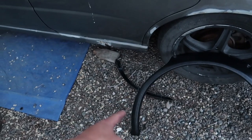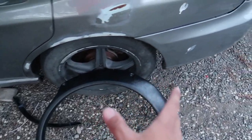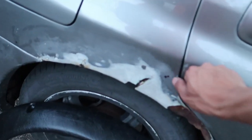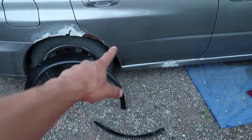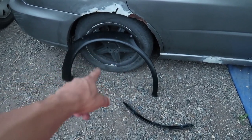After looking at this for a bit, I think I can make them work. I'm pretty sure I can make the door piece work and make the rear fender work — it's going to have a lot of stretching, but I've got all my markings on this side. I think I'm going with a dot up here, one here, and then one down there. The door piece I think I'm going to shave so it fits flat with the flare. Right now I'm out of well nuts — I could drill and use the well nuts off the front, but I really don't want to take off the front flares because they were not that easy to put on. So I'm going to pull off the hood and swap on the old hood so I can work on this one.